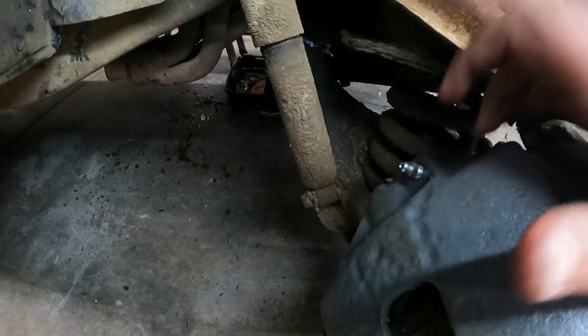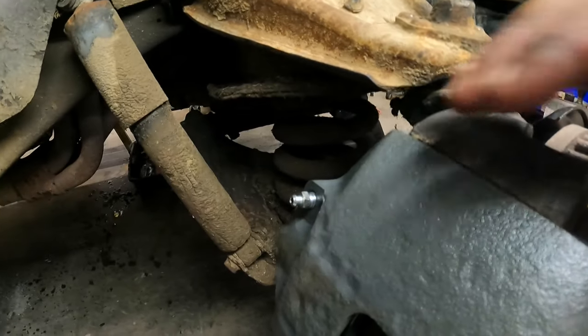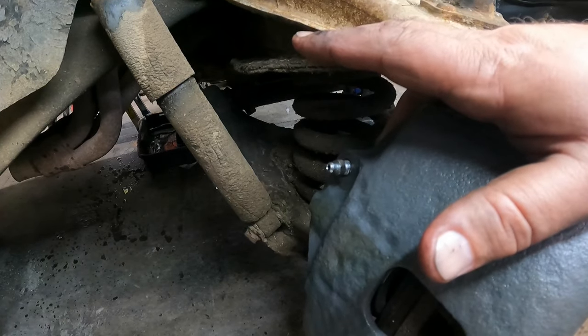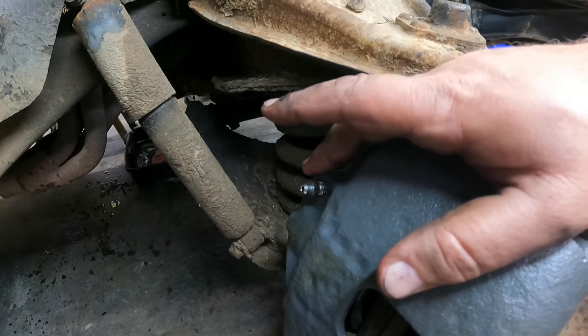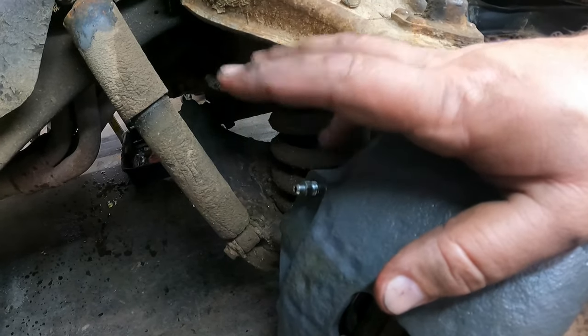You know, obviously there's your brake bleeder. And again, I said it before, and if you're not sure which caliper's which, the brake bleeder always goes at the top. So that way, you know, a bubble's going to want to rise. So, we sat there, we bled it out quite a bit, and got a good bit of air out of this one, which was to be expected because it's a whole new line and a new brake hose. So, a lot of air came out of this guy, quite a bit came out of the driver's side, but yeah, that pedal's all there now. I think it's only got about maybe that much play before it just starts really throwing some pressure down.